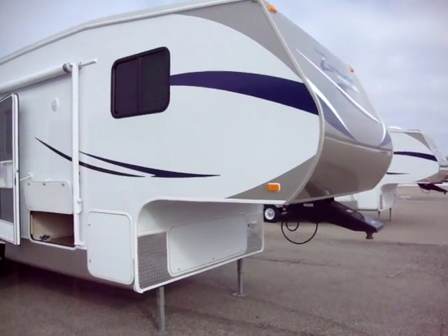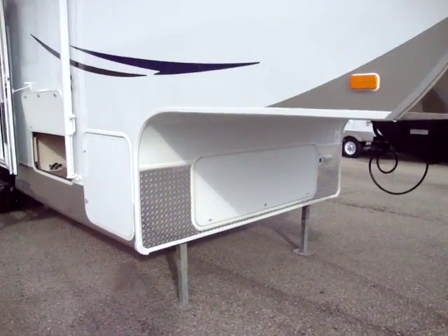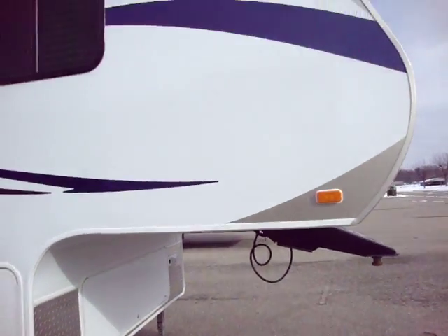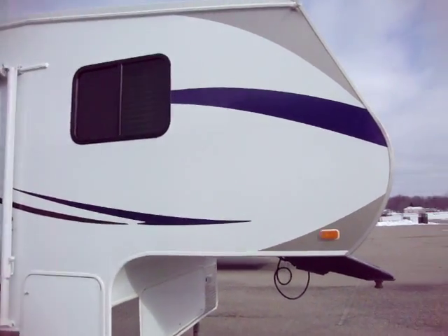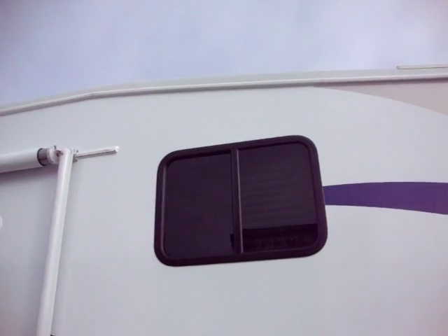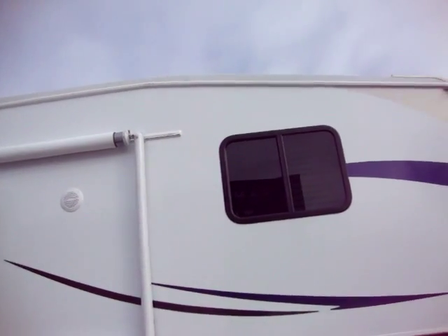One of the first things you'll notice on the newest model of the Zinger is the champagne front end. We also have a lower diamond plate on the front section here. We have power front jacks. This Zinger has optional fiberglass exterior. You'll also notice on the front the three inch gutter extensions, trying to keep the coach as clean as possible. On the Zinger roof line they have a nice three inch rollover of the rubber roof. A lot of brands butt that gutter rail right up against the top — Zinger actually rolls it down, giving it a smoother look and also extra water protection.